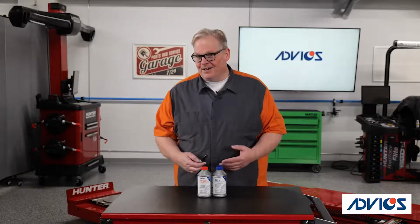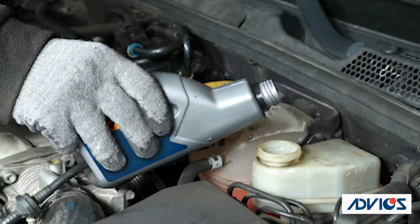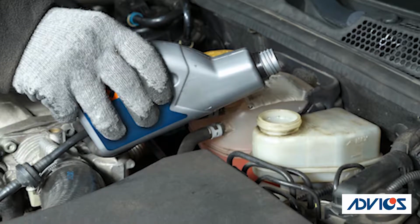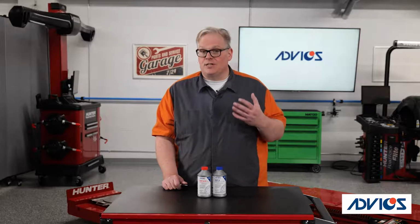An open bottle, well, that's a different story. Even if you poured out a little bit to top off, let's say, a master cylinder, you've introduced moisture into the equation. And this process of absorbing the liquid from the air has begun. Most manufacturers recommend that an open bottle of DOT 3, 4, or 5.1 should be used within a year and then discarded. If it is not discarded, well, the quality of the brake fluid has been compromised, and the boiling point, chances are it's changed and it's outside of its DOT range.